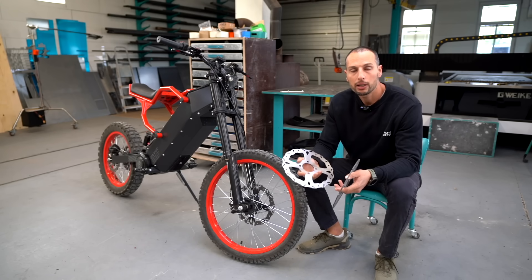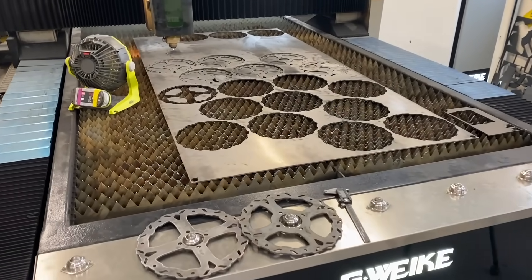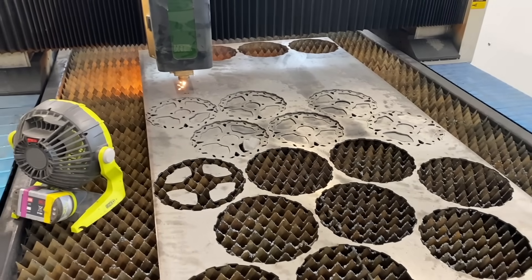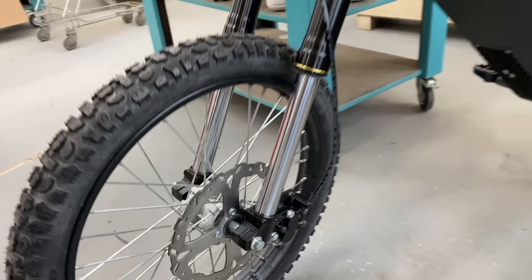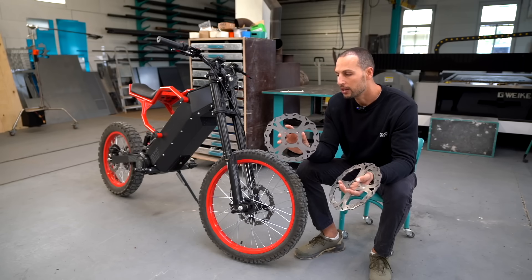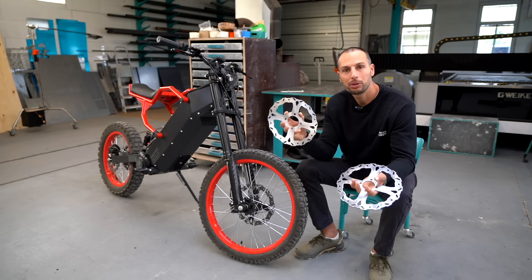At the beginning we were not able to find big enough rotors, because obviously 220 millimeters was too small for this heavy and this big bike. There was no other option than making our own. With the CNC laser cutter I copied the rotor pattern we have at the back — the 220mm we buy — and copied the same pattern for the front one, just bigger: 260 millimeters and four millimeters thick. It's a solid rotor. They warp a little bit so you need to harden them — it's a hassle for such a small part. Now we have a manufacturer producing our own design, proper professional-grade rotors, and we just unpack them and mount them on the bike. Beautiful improvement.